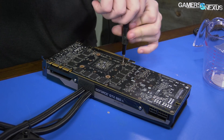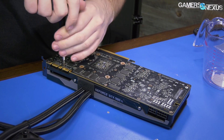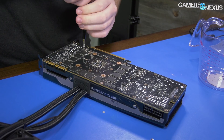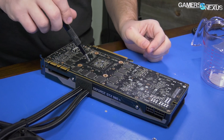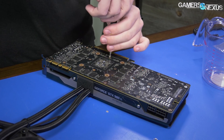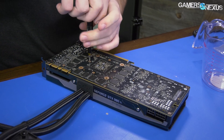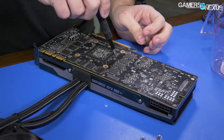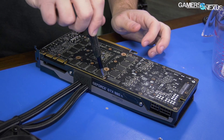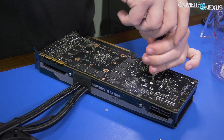This card was in the render machine and it's been through a lot — it's got a liquid cooler on it obviously, and the CPU radiator is positioned above it, but it was still operating reasonably cool. We have three front fans in the case so it should be getting enough air to the GPU. It should have been okay thermally from our end. It's possible the liquid is reaching 60 degrees or higher, but that's pretty unlikely in a case as well-ventilated as our PM01.